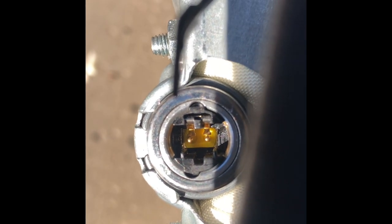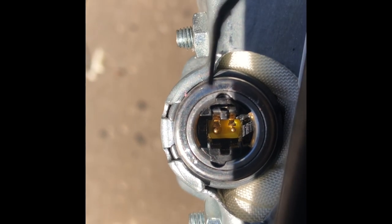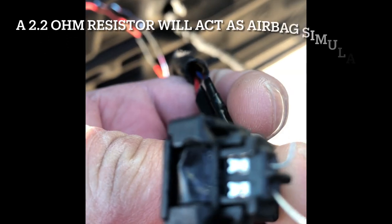There's actually a shorting wire in the connector. When you insert the plug, the plastic moves the shorting wire so the connection is open. But when you remove the plug, it springs back and short-circuits the pins. The previous owner probably messed up the socket when they removed the door card, breaking that mechanism — which is why I have a fault. You can see the connector is kind of mangled; they clearly forced it open without knowing how.